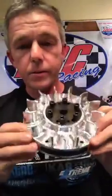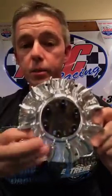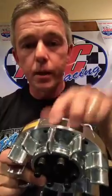But anyway. Alright, as I was saying, for those of you that want adjustable timing, we make the 6617. This flywheel here, like I say, looks like a 6618, but it's not. PVL ignition, dual magnets. If it does not have the dual magnets, it will not work with the PVL coil. I cannot say that enough. I get phone call after phone call after phone call.